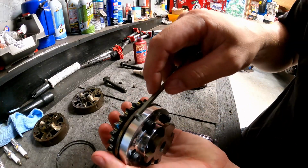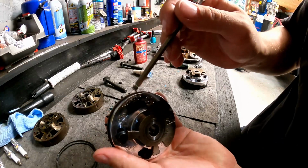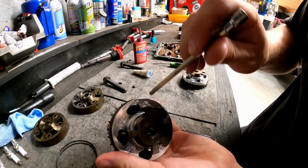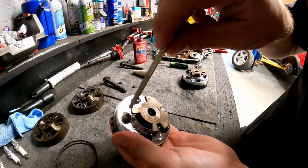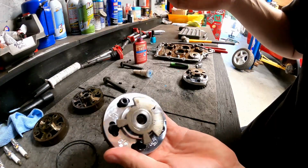There is no mark on here, and there is no mark on here. So the only point of reference you have is your bolt. It's just how it is. 0 degrees is where I'm setting it, and I'm going to try to measure just for lift, and then if we can do just lift, crack this loose, get our lift, tighten it back up, we'll be good to go.